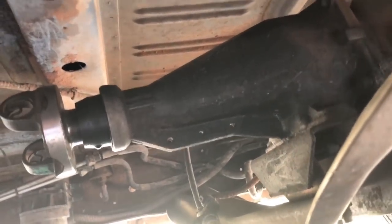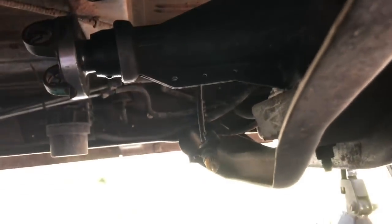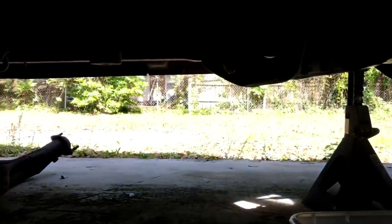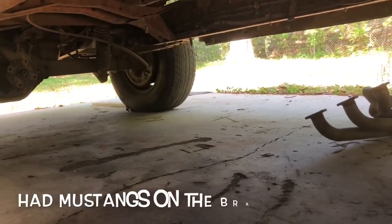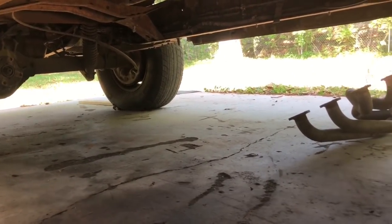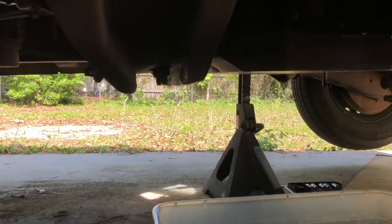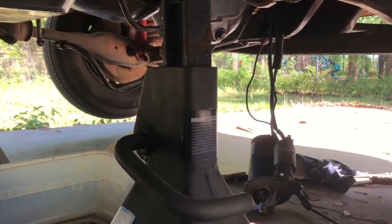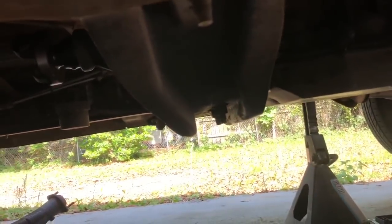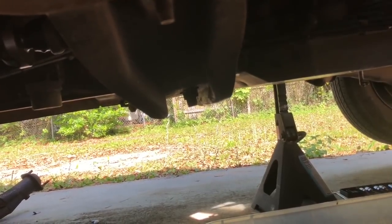Depending on where our drive shaft sits, we may have to get the Steeda drive shaft spacer that a lot of guys use when they're doing a Fox transmission in an SN or whatever. That should give us enough length to be good to go, but we don't know till we get there. So anyway, I gotta go get another tool. We'll finish unbolting the converter, and then we'll just have to take the crossmember and boom, it'll be ready to fall out. So goody gumdrops.